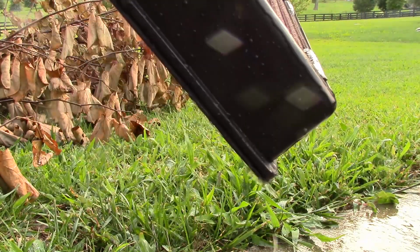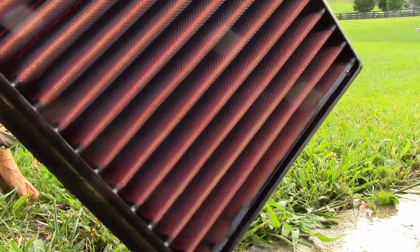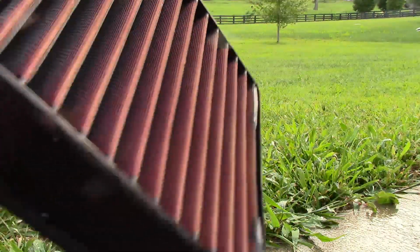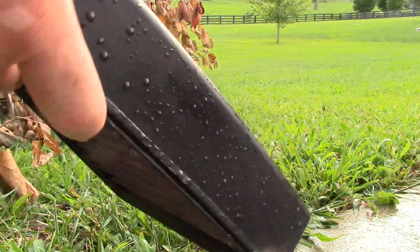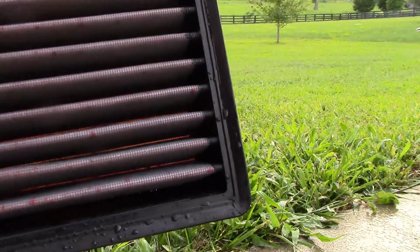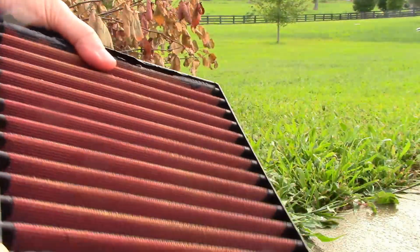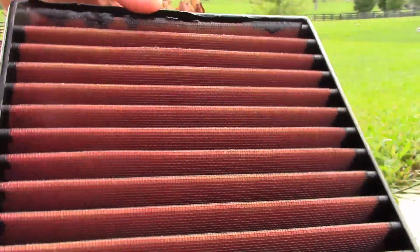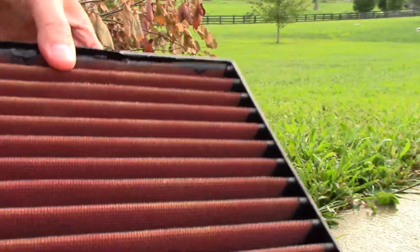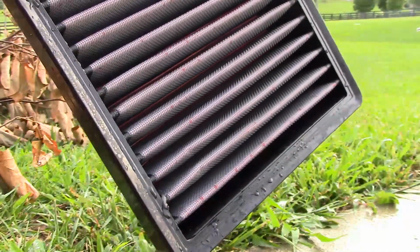So probably if you have another spare air filter, you put that in while you're waiting for this one to dry. And you can use a light air compressor to blow through it, but don't use anything too strong. But again, blow from the clean side through to the dirty side. So there we go. There is my new clean air filter. And after it dries, I will put it back in the truck. So hope this helps. Thanks for watching. See ya.